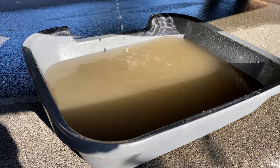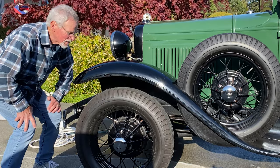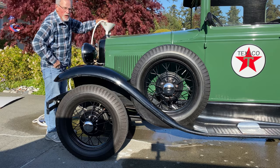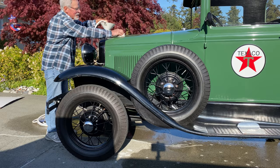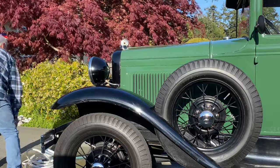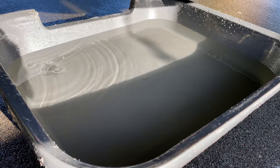The second water flush is just about the same color as the first. I'm getting a little impatient with this — I'm losing my light soon, the sun's about to set. So I'm just going to stick the hose in there and keep the drain open and see if I can clear it out. Definitely going to be washing and waxing it before the parade. Our water here is hard and it leaves marks. We're going to overflow — got to slow the hose down a little bit. I'll continue without recording and get this done. It's now, in my opinion, clear enough to put in the coolant.